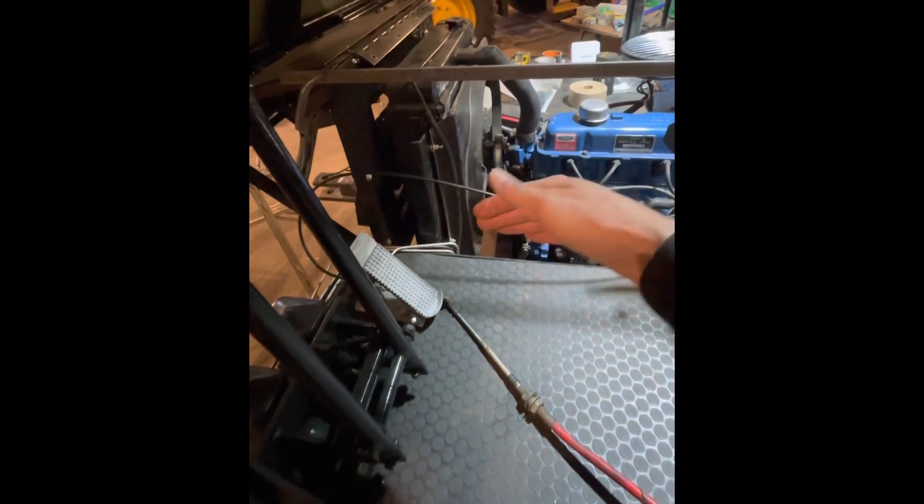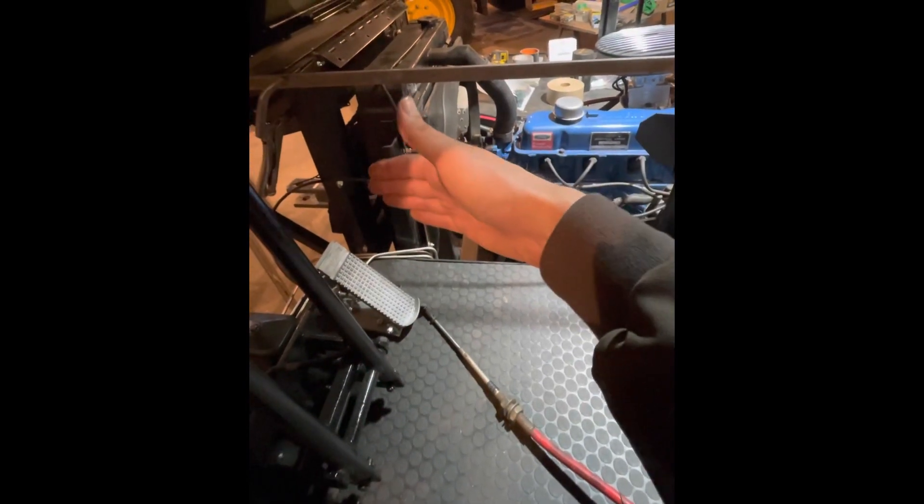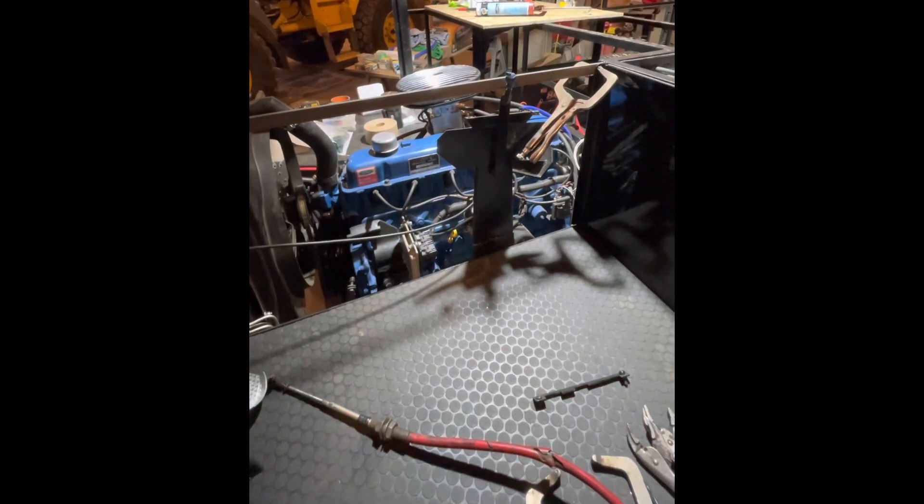This old cable is a Morse cable, common on all snowcats — it's a push-pull cable. This one is all cracked out, getting hard to shift, and not as flexible as it once was. We're going to cut the shifter off, move it up, and fab it in place. We might go with a bolt-on option if we can make it rigid enough — bolt it to the tub and to the radiator bracket, giving us flexibility for any future micro-adjustments versus welding it.